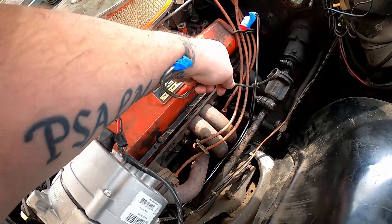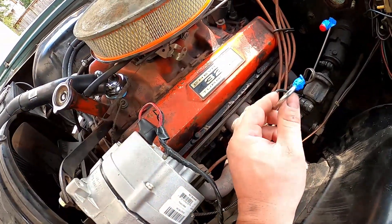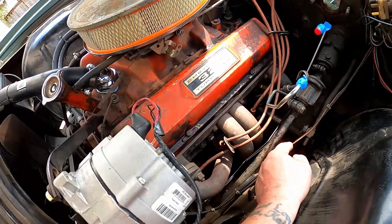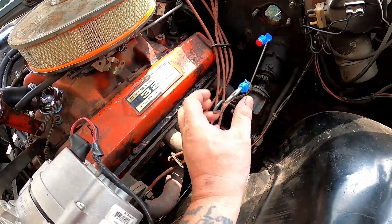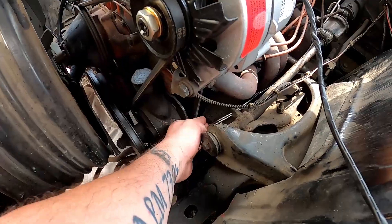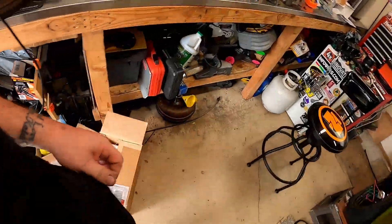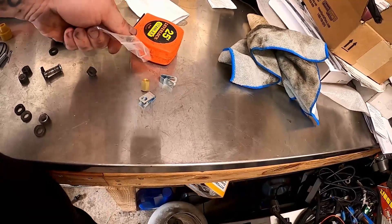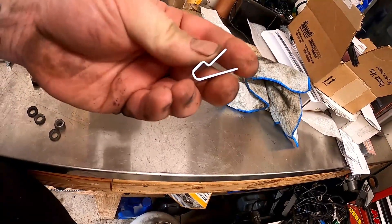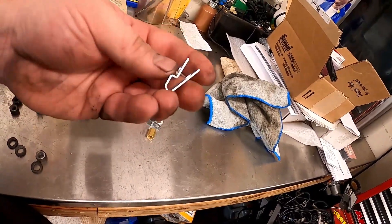They are roughly in — and I mean rough. I'm not sure if they need to be flipped on this side; I have a feeling they have to come underneath this. I'm going to hold the master cylinder up there to check. There are clips on the frame — here are some new clips — and they have to hold the double lines down there. Right now there's only the factory single line, so these new double-line clips have to go in there.